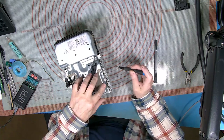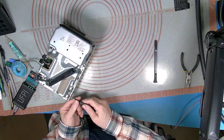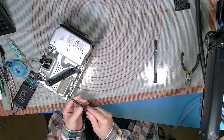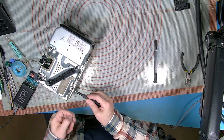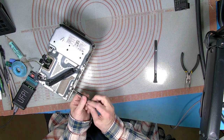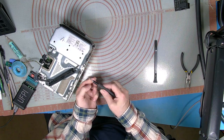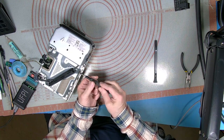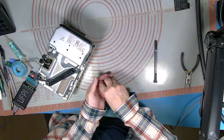If you've got the right type of chip, actually making them work is not a big problem, providing that you've got the Xbox file system off the previous chip, which in most cases you can retrieve from some chips that fail, but not all. If you can't get it and it's failed, then I'm afraid you're in the pool again.